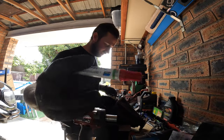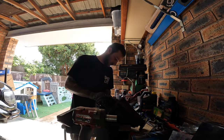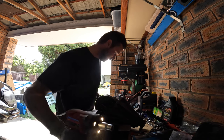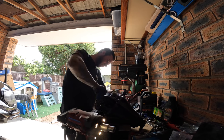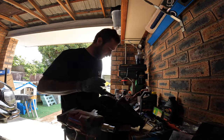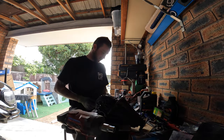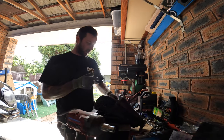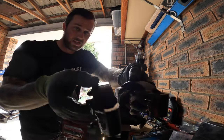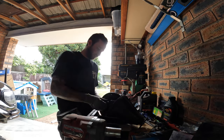So I've got the diff center out on the bench. I've got a paint texta — I have to mark one of these sides so when I put it back it goes back the same way. I'm going to take that locking tab here and get that off. This side here is going to be my side that I mark. You can mark it, you can center punch it, you can do a few things — I'm just putting two big red marks on it with the paint texta. We're pretty much just going to undo all this, take the center out, and have a look at the pinion. The reason you mark them is because they're identical and you just want them to go back the same way. The diff was good beforehand, so you'd hate for it to go back any different.